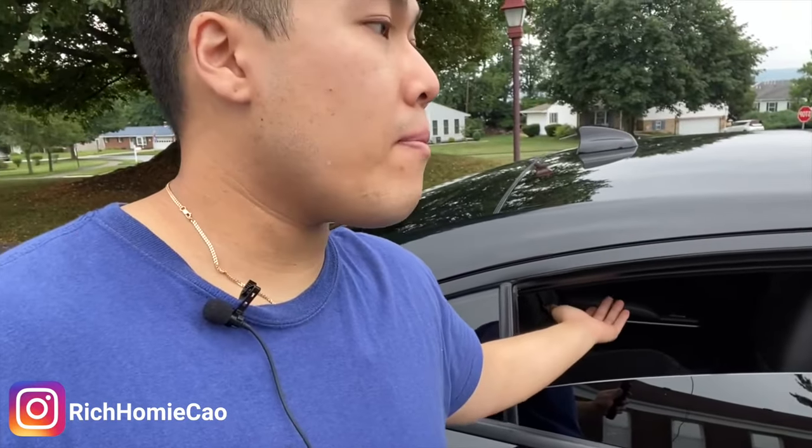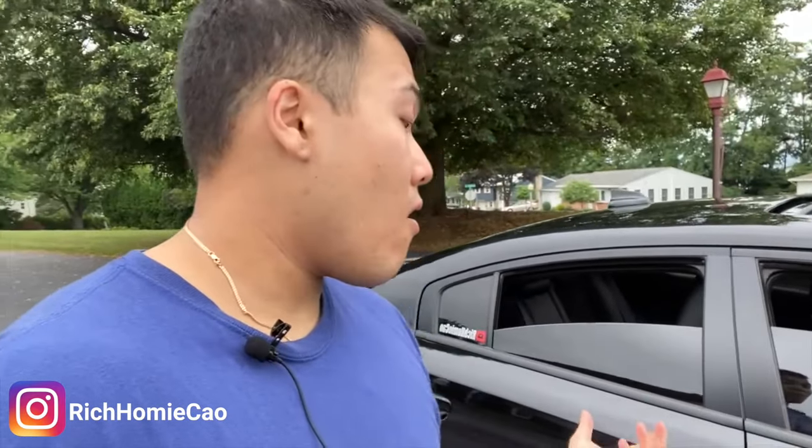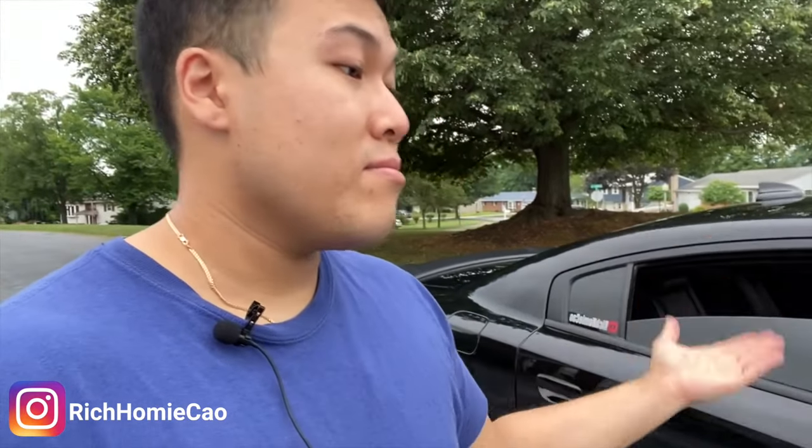Just want to thank everybody for watching. It was a different day where I had to install the rear map lights because you are supposed to have a T30 screwdriver and I was not prepared, so make sure you have a T30 screwdriver. Pretty simple install — the only thing that took a little longer was the rear map lights. Everything else was super easy, and it makes the interior look 10 times better without those yellow incandescent bulbs. The LEDs just add a whole other atmosphere to the car and make it worth that $40,000 to $50,000 price tag.